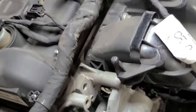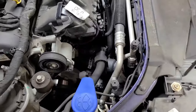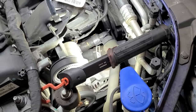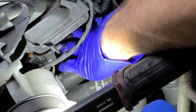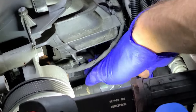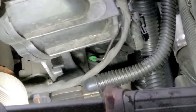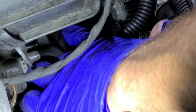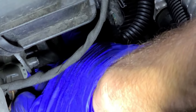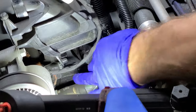I'll show you my tricks for releasing these because this is actually the second time this valve has failed — I've got 162,000 miles on the car. The green connector operates just like the one on the tank ventilation valve: you mess with the ears, which allows you to pull the tab. Push the ears to the rear, then pull the tab down. Using a pick really helps here, and that one's off.